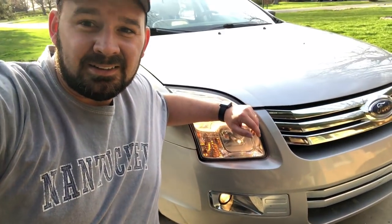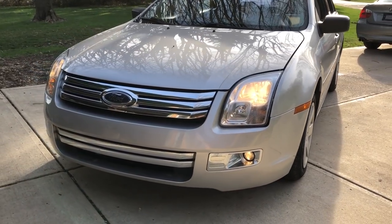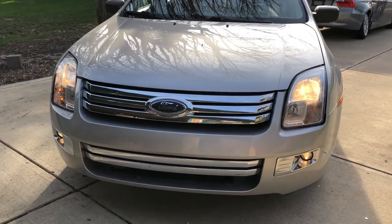When I bought this used bumper for this car, I received with it the fog lights that were installed on the higher trim level. Now, this car didn't come with fog lights — it just came with some black blanks that went in the fog light holes, and as a result it doesn't have the switches or wiring for fog lights. But I was able to trim some fog light wiring off of a car in the salvage yard a few weeks ago, and I just wired them up to the electronics so they come on when the parking lights come on, and they look pretty good. The fog lights are working — they look great, and that's just a little something extra for the next owner of the car.